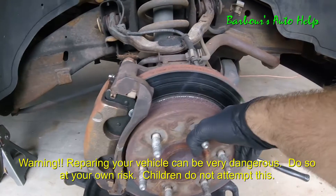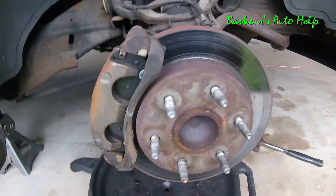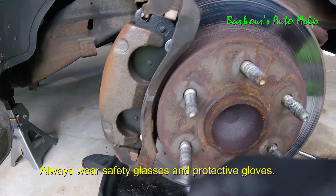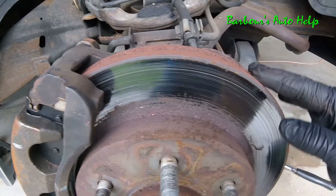You can see right here I just applied the brakes earlier and I cannot spin that rotor. You can see just how hot this thing's been getting — all this paint is peeling off right here. The rotor is orange, very orange on the outside here.